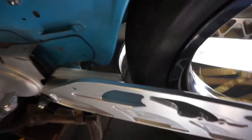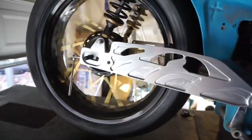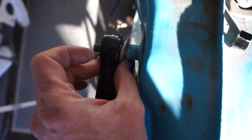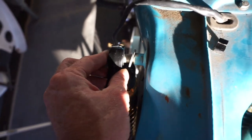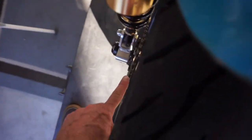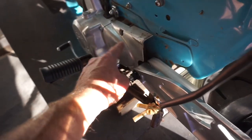I actually need to paint the sprockets and this guy, and then I can put it on. One problem — see my shock? If I go all the way in, I'm going to be hitting the tire. I'm going to do something about that — probably drill a pilot hole there and then put some spacers with a screw so that it doesn't slide off. The other thing is the chain is going to hit the tire from the sprocket, so I'm going to have to take the sprocket off and space it out a little ways. Same thing on the other side.